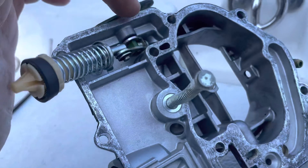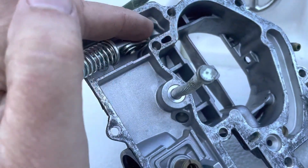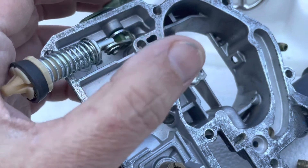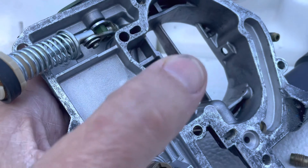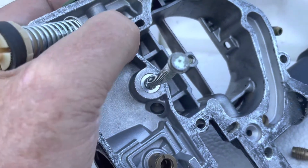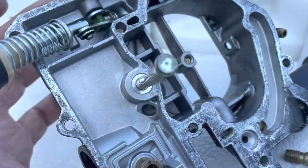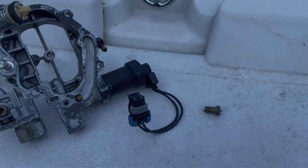I also want to note that I did test this power valve plunger. I took a hose connected to my truck's intake manifold to create vacuum, applied it to that hole right here, and it sucked the plunger down in there. I wanted to make sure this power valve actuator plunger was working and that it wasn't the power valve itself. The plunger worked fine when I applied vacuum to that oblong-shaped hole, so if there was a problem it had to be the power valve. Thanks for watching, and subscribe to my channel if you haven't already.